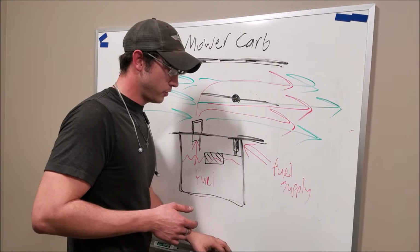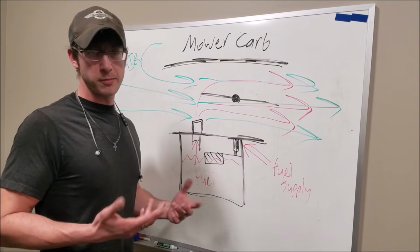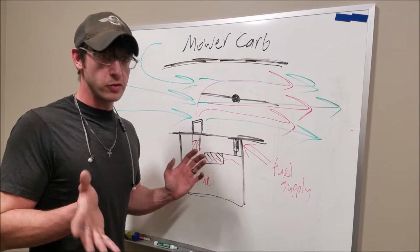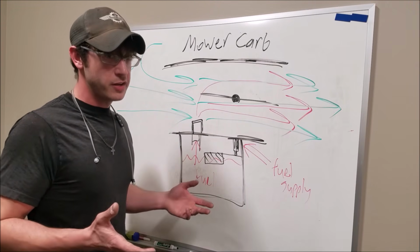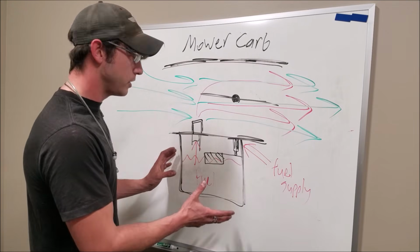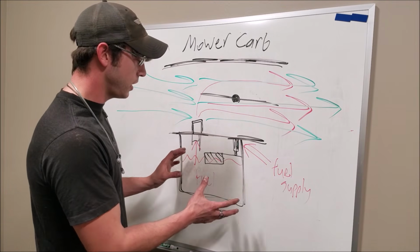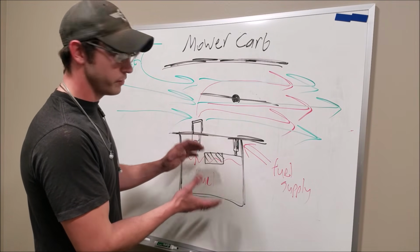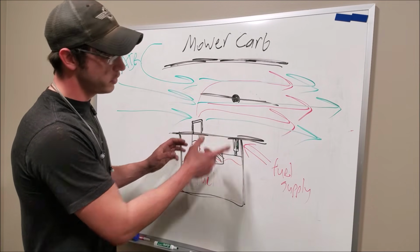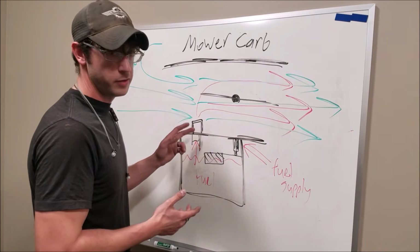Alright, so getting back to our video here, one of the main concerns that I keep reading that people have, other than calling me an idiot for trying this, is that, you know, oh no, you're going to suck the fuel bowl dry. You know, potentially, but I highly doubt it, and here's why. The first thing I want to mention about a carburetor is the fuel bowl is not a reservoir. It's specifically designed and set up with the float height and the fuel height and everything because it has a direct relationship to the low pressure area of when the piston goes down and the fuel is drawn out of the main jet.